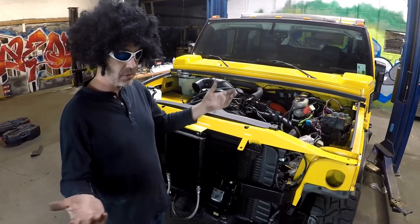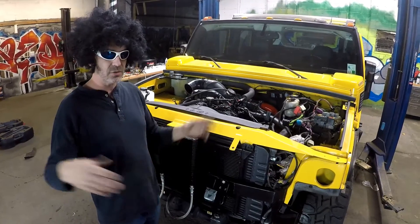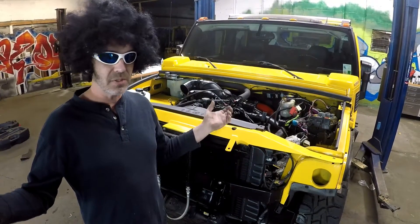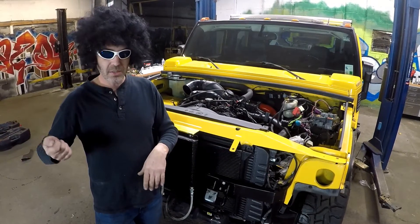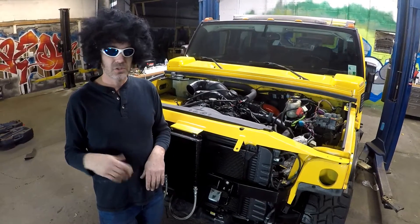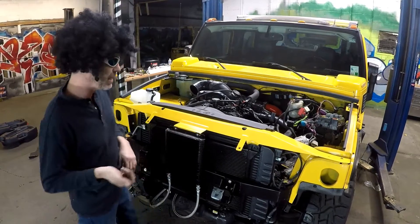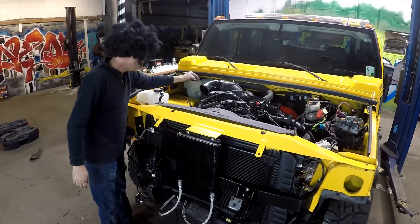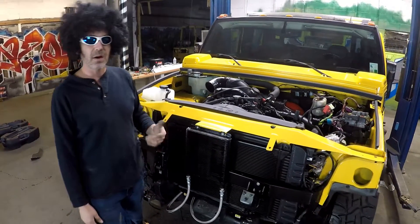Program it and follow what it says — it'll say congratulations, turn the key off, power is now increased. At that point turn the key to crank and it should start up. If it doesn't start on the first try, don't freak out — come back out, pump the primer bulb until it gets hard, go back in and try again. It should fire up for you.